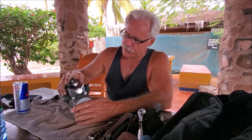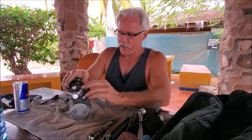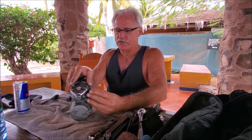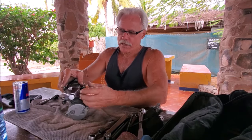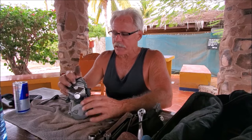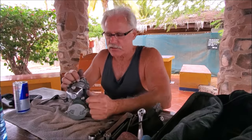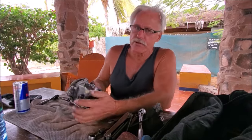So the power from the battery comes in here, but the motor is here. You see the way this wire comes out the other side and goes into the starter motor — this thing's job is to connect these two. It connects the power to the motor, bang, it engages it. That's part of its job; it does two things actually.